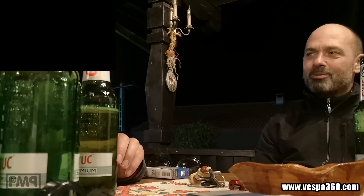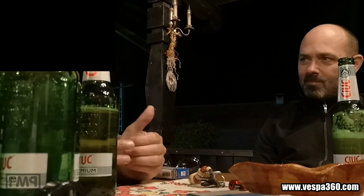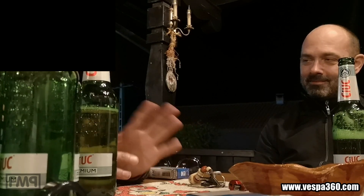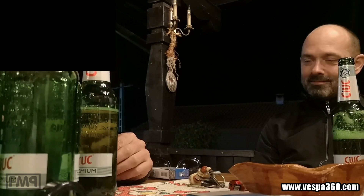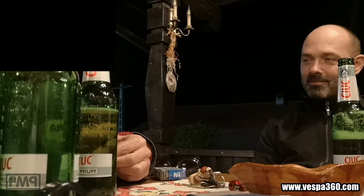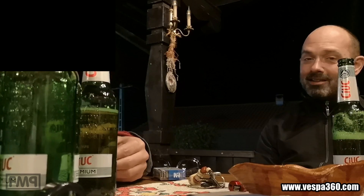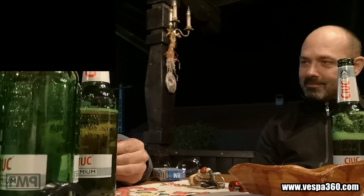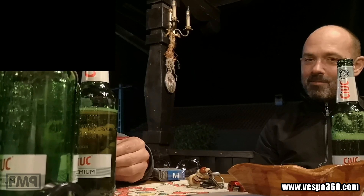The biggest difference I noticed is that the Molossi kit — when both bikes get into the top end they're both quick. The O-tune motor screams from six to almost eight thousand. But it's that point from four to six thousand where the Molossi really wants to go — it's very powerful — whereas the O-tune motor is not throbbing or wanting to rev up; it just sits there lazy like the original engine, but much smoother. The Molossi is chomping at the bit to get moving in that rev range.